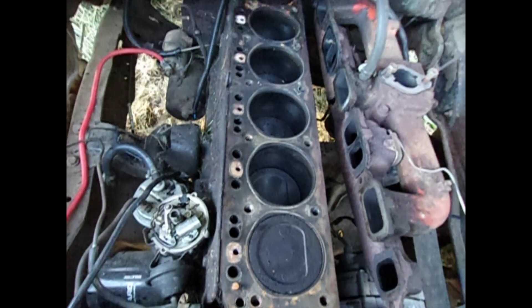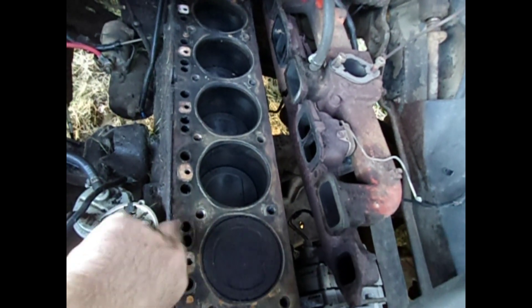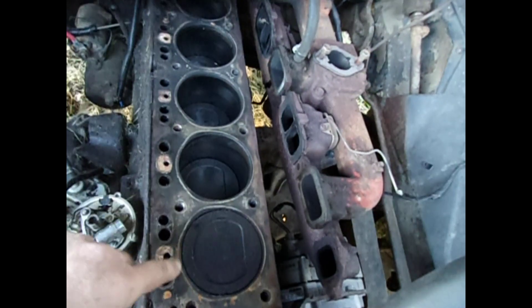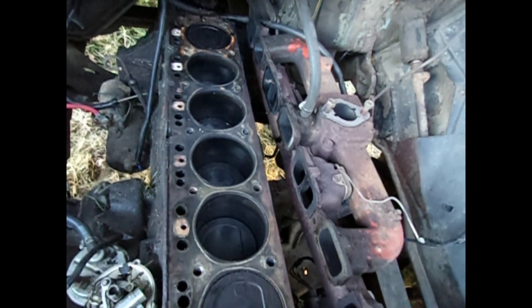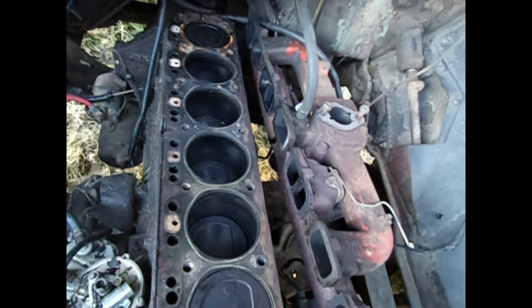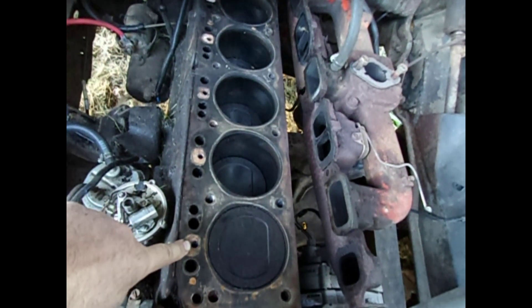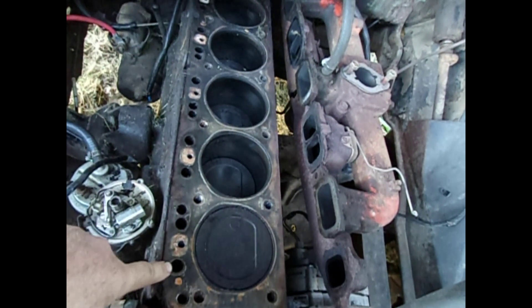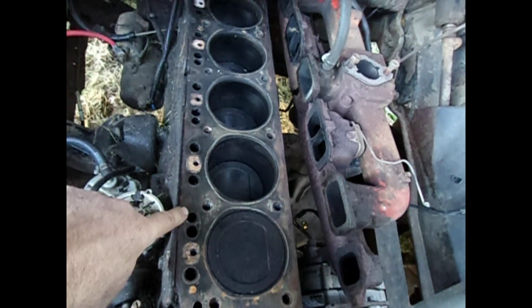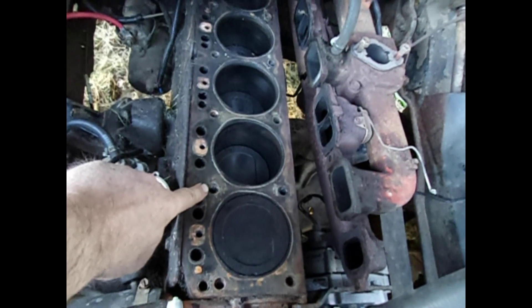I haven't finished cleaning off the surfaces. I also need to get up all the gunk that fell into the cylinders and flush down the pistons, because I don't want that to damage the valves. I also need to be careful of getting gunk into the coolant holes, the pushrod holes, the oil drain, or even the threads.